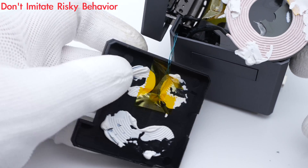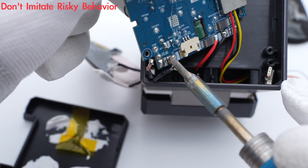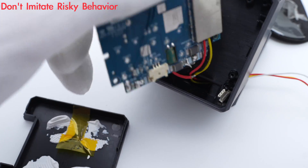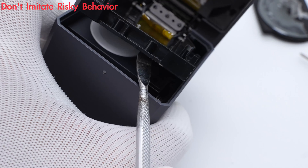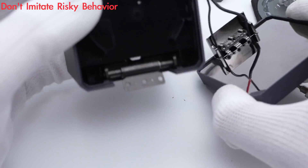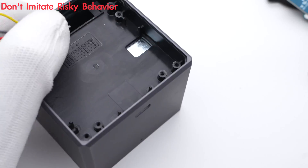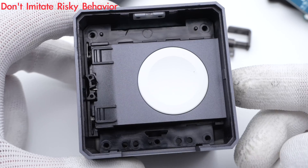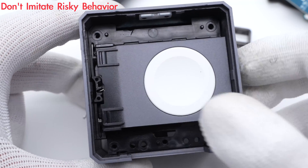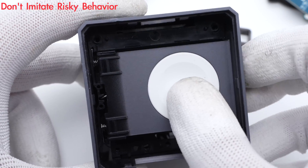The wireless charging coil and the thermistor are pasted inside the panel. Then disconnect all wires from the main PCB. The top panel for iPhone can be separated from the bottom cube. Continue to take out the plastic frame in the middle. The wireless charging panel for your Apple Watch is hidden here. It's locked by a hook in the middle — a slight push can unlock it, and the module will be pushed out by two springs.